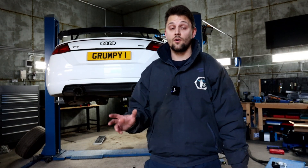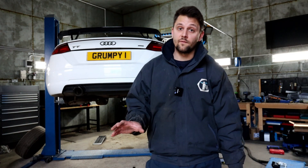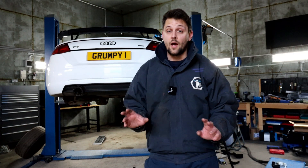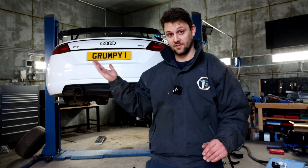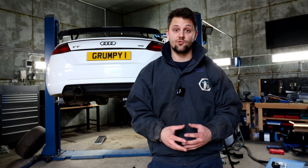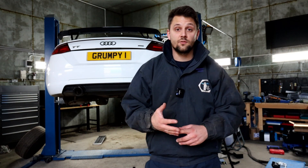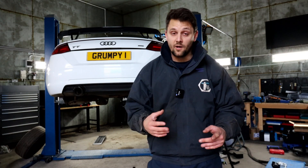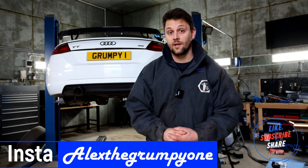Here we are — I hope you enjoyed the video. Only do the function on the diagnostic tool once you replace both sides, so that should be fine. From there you shouldn't get any faults. If you do, just clear the fault codes and you'll be fine. Don't forget, before you drive away you have to pump the pedal to make sure it goes hard, because obviously the piston was all the way in. Check your brake fluid level and just be careful when you first drive because the brake pad is going to be bedding in — the brakes aren't going to be as great as before for the first 10 miles probably. So just keep using the brakes and you'll see it improve over time. I hope you enjoyed the video. Links for the tools and parts used will be in the description below. If you enjoyed the video, give us a like, comment below and have a good day. Bye.